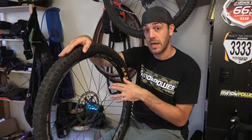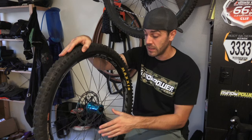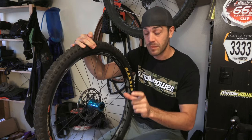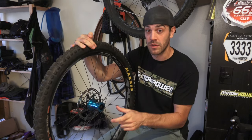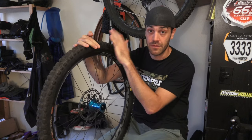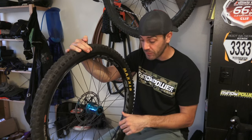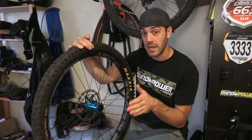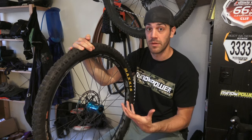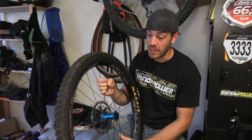If I were to run a smaller tire like I used to, it's going to be a lot more agile — I'd have a lot more play and really be able to put the tire where I want. But if I ran anything bigger, for me there's a loss of control — the tire is now so wide it's just going to pick where it wants to go and you're not going to be able to move it around as easily since it's covering such a large surface area. So I run 2.5 in the front, which gives me just enough to push through chunky stuff and hold on roots, and I run 2.3 in the back. You don't exactly need to guide with the rear tire — it's more of a follow tire — so running a little smaller allows me to go a little faster with a little more control over my back end.